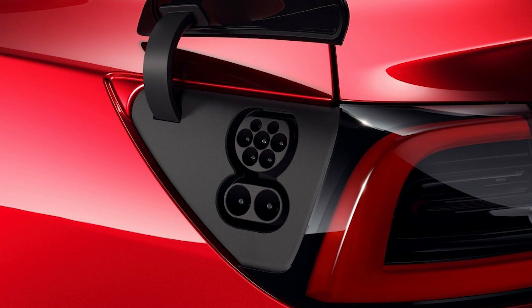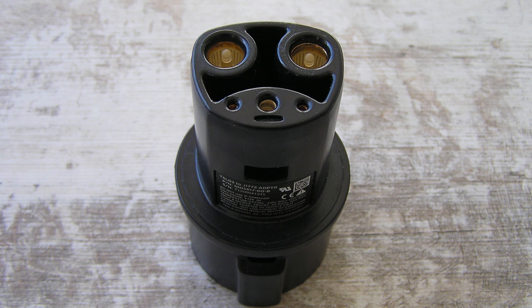The reason Americans have a Type 1 CCS and we have a Type 2 CCS is because those are the respective AC plugs for each region. It means you can fit one plug to a car capable of doing AC at the top and DC at the bottom — the top half handles the car's communication and the bottom pins do the DC fast charging. It's a very neat idea — one plug does the job of two. In the UK, Tesla used Type 2, and the Model 3 now has Type 2 with CCS. American Tesla owners have a proprietary plug with a Type 1 adapter and can get CHAdeMO adapters. In Europe, you can also get a CCS adapter for the Model S. I hope this clears up questions about plugs, chargers, AC and DC. There'll be more in this series about how electric cars work — thank you for watching.